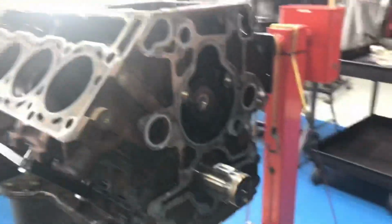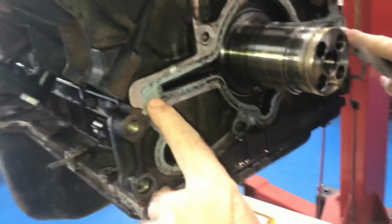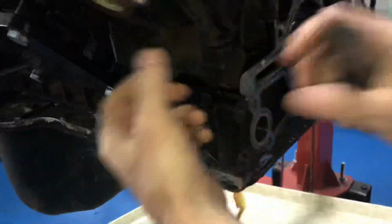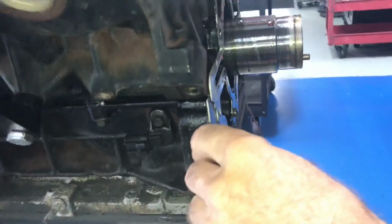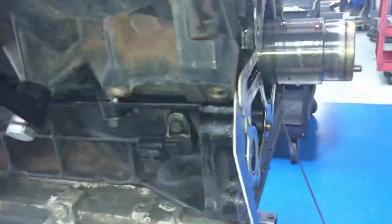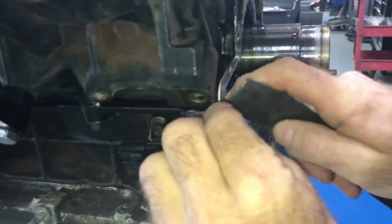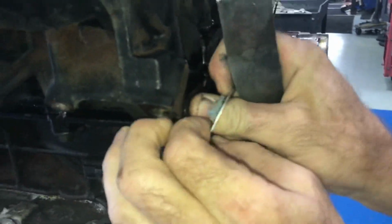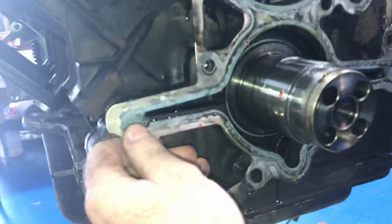And right here, this is the second half of it. Here and here. These two spots right here, don't play around. You'll pull that bed plate gasket out, you'll stretch it, and you'll actually do more damage than good by trying to do a bed plate. So you can either use a putty knife or a razor blade, because ideally we would cut the plastic away like this, if it'll cut, and then press on it and push it out. See that? See, I left it, right? That's the most ideal, but you can get back behind and scratch it.